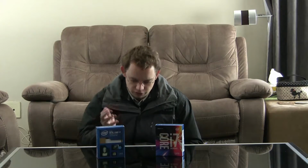If you're looking for a little bit of a higher end build and you're looking to go for 140 watt processors, which basically starts with something like the 5820K, compared to something like the more basic i7s, this is a 6700K. You gain 2 extra cores and you gain 2 extra channels of RAM. That means you can, instead of dual channel RAM, run quad channel RAM, which makes quite a big difference. This 5820K is still what's available on the market, but it's soon to be replaced by a 6800K, which is basically just a newer version of it.